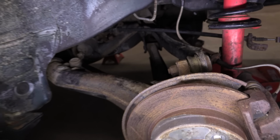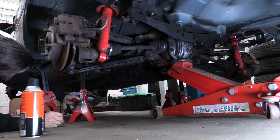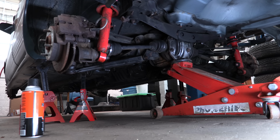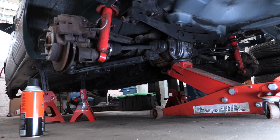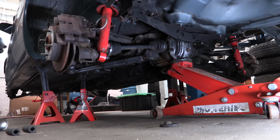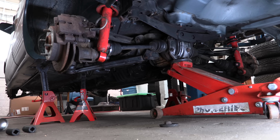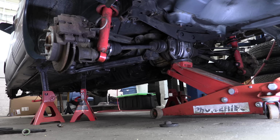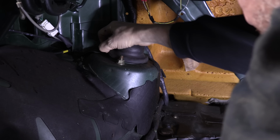You saw that I left some checkboxes blank in the last video. Had to work on a different project for a bit, but this one's not taking a rest at all. You can see that. Aside from the 6 nuts and bolts of various sizes that I was referring to in the previous video that secure this subframe to the body, there's also 4 14-millimeter nuts in the trunk for the struts that make the same kind of connection. The mustache bar nuts are 22s, the front subframe mounts are 19s, and the subframe bracket bolts are 17s. Including the strut mount nuts, it's only 10 fasteners total, and we can very easily lower the entire subframe assembly to the ground in one piece.